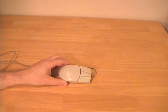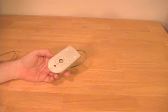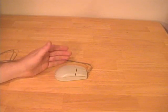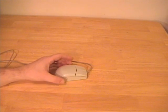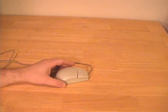If you use a mechanical mouse — the kind of mouse that has the roller ball in it — you should clean that periodically as well. As the roller ball rolls over the desk surface or the mouse pad, it picks up dust, dirt, and oils from your hand. This dust and debris can collect on the rollers and on the ball itself, which can make the mouse pointer jump and skip as you move it across the screen.